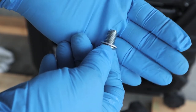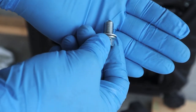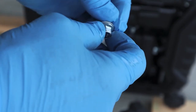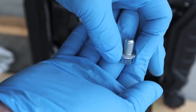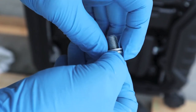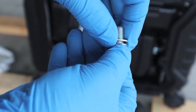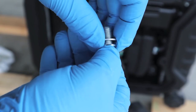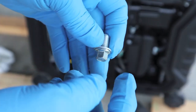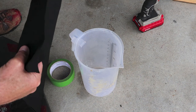Just a word on the drain plug — it's a nice looking drain plug, plenty of deep threads, looks like slightly over a half inch. As I said, 10 millimeter, six-point. The gasket is a nice solid aluminum thick gasket on it — it will not just flop off, you're going to have to unscrew it off. That's a pretty good deal. I've seen chintzier drain plugs. I like this one.